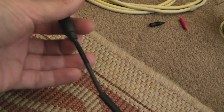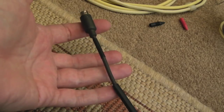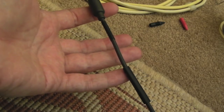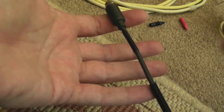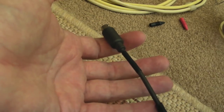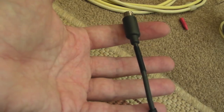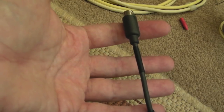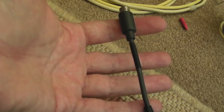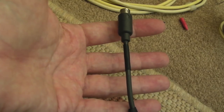One of the reasons I'm showing you this, I could swap out to the connector, but I'm just trying to show you techniques you can use to repair cables and things, where perhaps the connector might not be available and the break may well be in the middle, or somewhere else. You flexed it and bent it, and you want to somehow reuse the connector and want a relatively reliable connection there. These are just techniques you can use. It'd be far too easy for me to just show you this on there and go, there you go, I stuck it on, wasn't an issue.